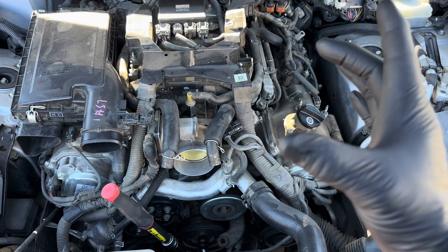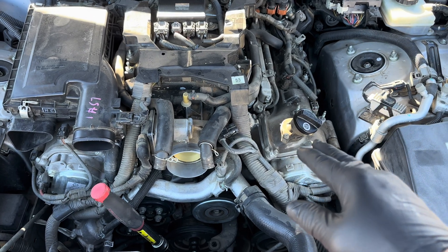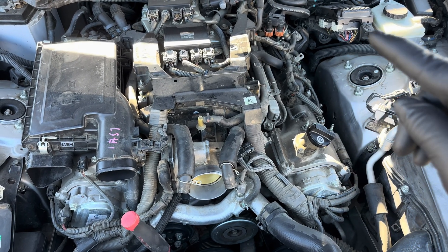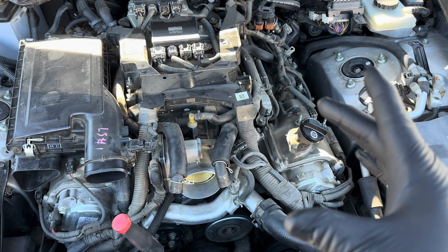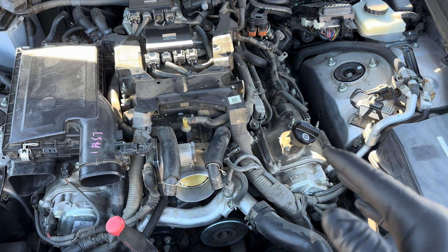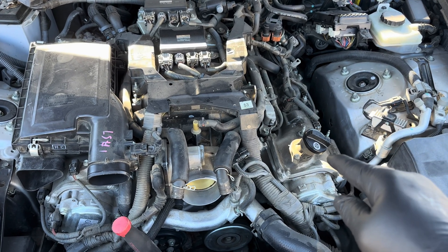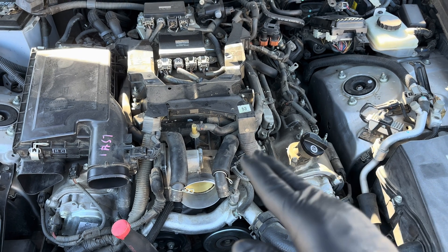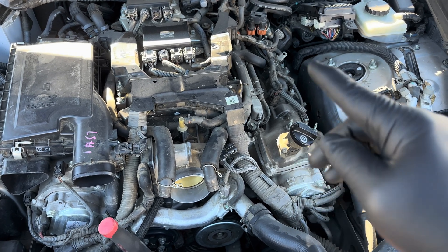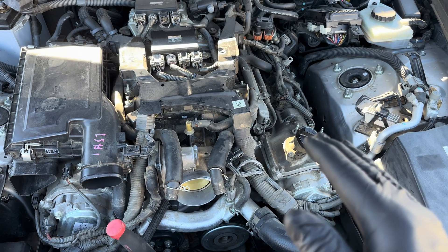You put a nice hard bore — plasma coated — then the rings and pistons, and these are hyper-eutectic high-compression pistons on this engine. You can see the carbon line along the edge, which usually means the oil ring is kind of stuck, and that carbon you see on the pistons is also in those rings. The only way to get rid of that is: one, run a cleaner through the intake to clean inside the valves and the combustion chamber; and two, use the Valvoline Restore and Protect. It'll take a few oil changes to dislodge all that built-up carbon and get those rings to stop sticking, because sticky rings will eventually lead to bigger problems.